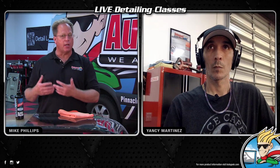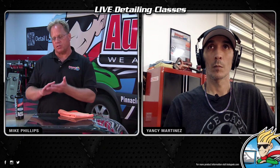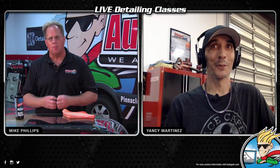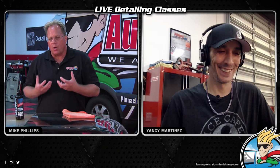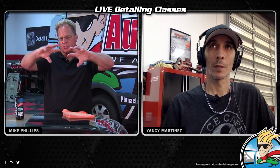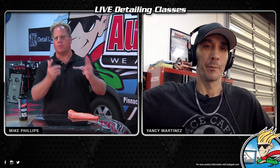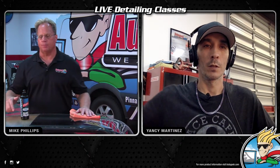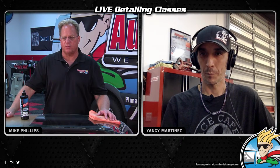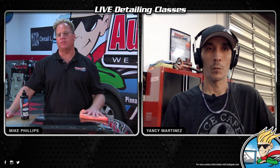So the polish has carrying agents. It's got the abrasives. It's got some sort of lubricant. Of course, it's usually got water. But rarely do I get to use the word matrix. So it's this matrix of products that you're smearing around the glass, and all that film that you're trying to get off gets mixed into it. Then you wipe it off, and you get everything that was on the glass off. So it's a real helpful technique. Sometimes if you get stuck with something, especially that's older or even newer, because it's got vinyl fog on it.